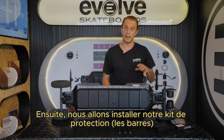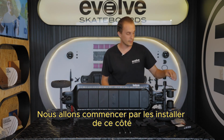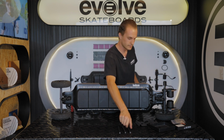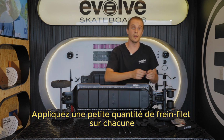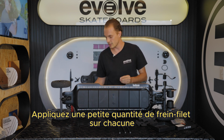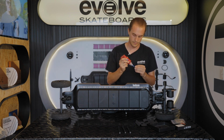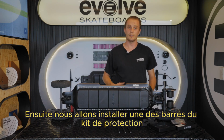Next, we're going to install our bash guard bars. We're going to start by bolting them into this side and then the other. As before, apply a small amount of thread locker to each one of the bolts before you put them into the bar. Then we're going to install a bar.